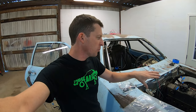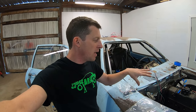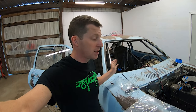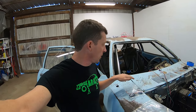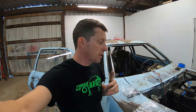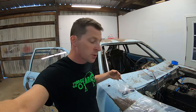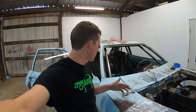It looks like chaos but I'm starting to work this thing out. About two hours in, going back and forth between the two cars - I've got the Ron Francis harness tied where it's going to be and everything else is trimmed off. Now I need to run the expansion connector wires from the PCM for the extra injector and coil wires. I'm also going to add nitrous wiring - I haven't said too much about the goals but this thing is going to get all the nitrous it'll take plus some. Boost control and O2 sensor stuff will go on the exhaust side, nothing else.